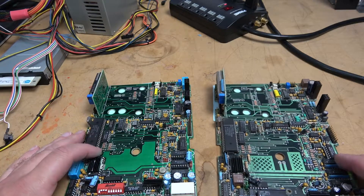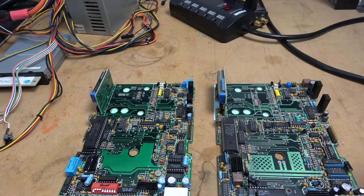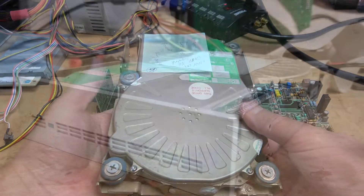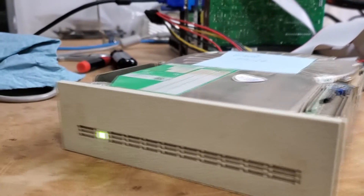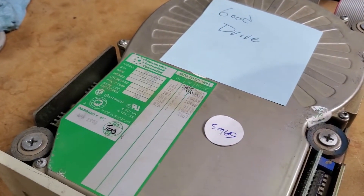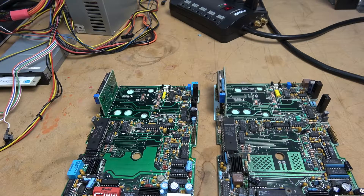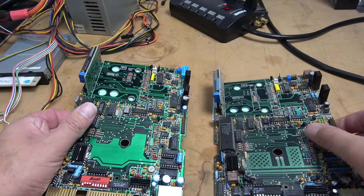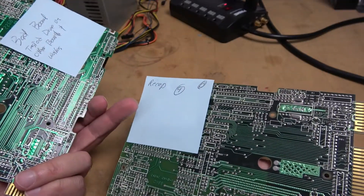As I was testing these drives, two of them had caught on fire. So far only one of the drives out of the lot worked to the point where it would power on, allow me to get into debug, and do a low-level format. It turns out the platters on that drive are damaged beyond repair. I messed with it for a couple of days and couldn't get anything to align — there was an error at zero, basically the very front of the drive where it really needs to set the FAT table and all the other important stuff. That's when I started messing around with swapping parts.